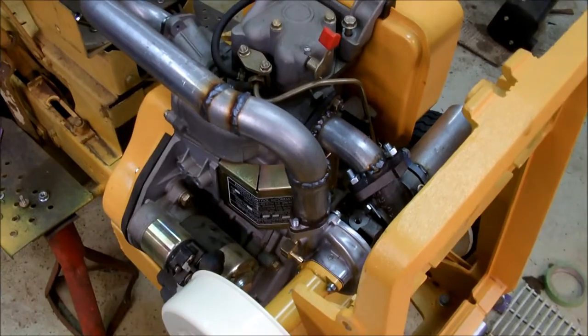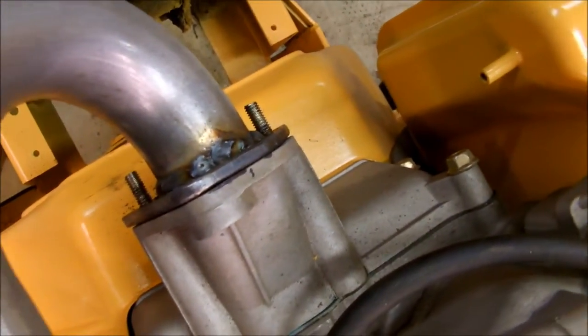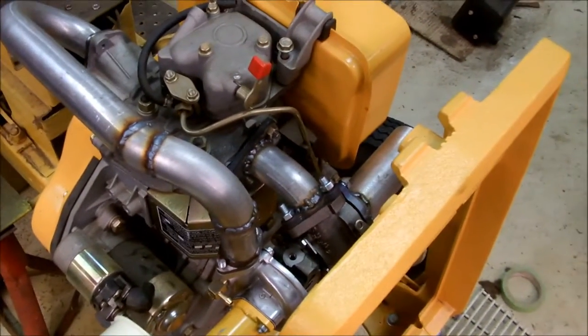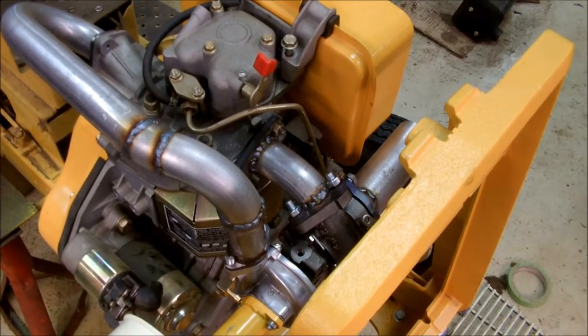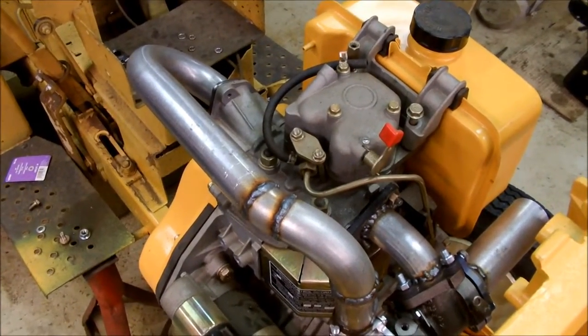Now I'm going to take them all apart again and paint them. I also grind around the studs so the weld clears, because of all my excess weld. So I'm going to do that on the hot side now — I'm going to bolt it back up and repaint that right away. I'll wait to paint this one until I cut it and put the radiator hose in.